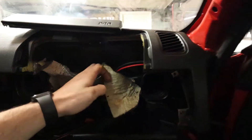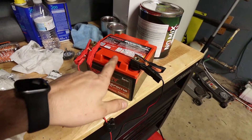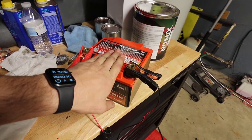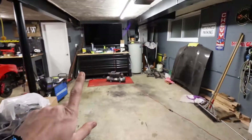That's just a couple of holes there behind the glove box airbag area. Those wires are running down here all along and back up through that little grommet that was already there from the factory, and that runs back to the trunk. So I just need to hook up the battery. I got a brand new battery — I wanted to go with something lighter weight. It's the Odyssey Extreme PC925, L positive on the left. I got a custom mount for this too. This is a much lighter battery than the factory one, which is this huge thing — that thing's like 50 pounds. So that other battery is about half the weight. I'm going to mount that in another video.